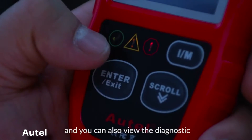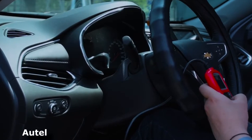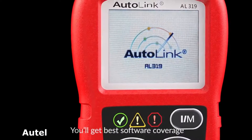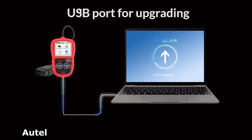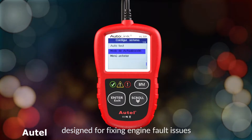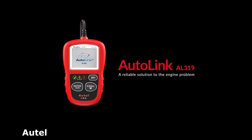There is a built-in speaker that gives both visual and audible tones. You will need to download the program from their website, MaxiLink V1.04, in order to update it to its latest firmware. Plug it in with the provided USB cable, follow the steps and it was up to date. This scanning tool works on all 1996 and newer vehicles. This scanner is set up for multilingual, providing both menu and DTC definitions in the language you need. The cable length is adequate and makes using the tool comfortable.